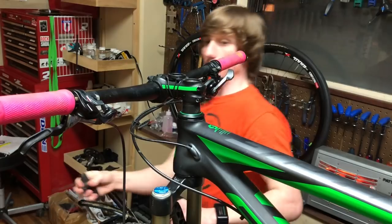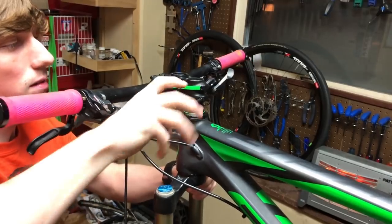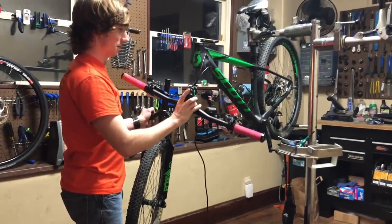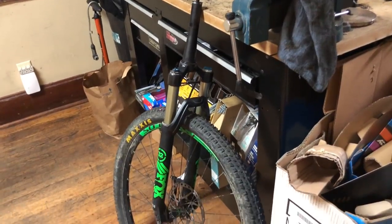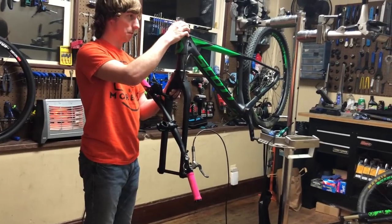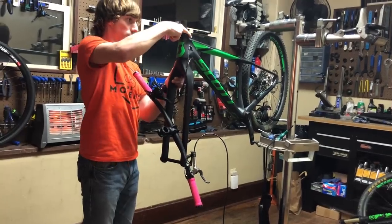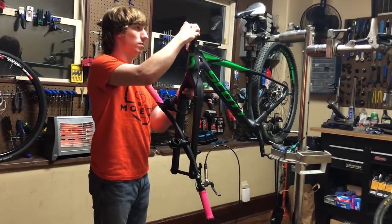However, I don't unscrew the side bolts all the way — just loosen them enough to take the fork off. Sliding the fork off is simple and easy once this is done. I like to gently lower my bars to hang for just a minute or two while I get the other fork. Once it's completely removed, I leave the mountain bike wheel on the fork for easy storage, and it's also ready to go whenever you want to convert back into mountain mode. Next, we slide our rigid fork into place. You can put any spacers on the steer tube once you get it all the way through the frame, to ensure that your bars are in the same position as before.